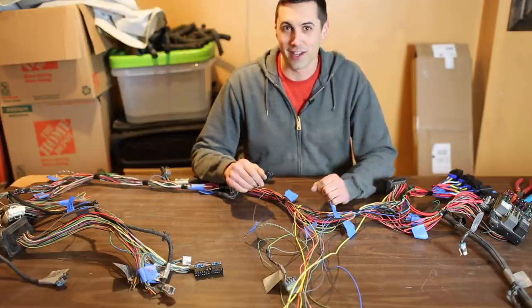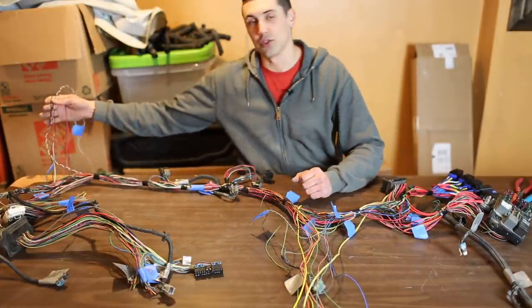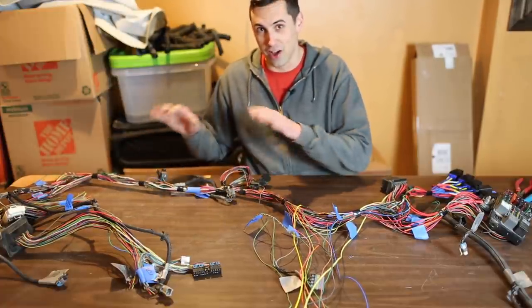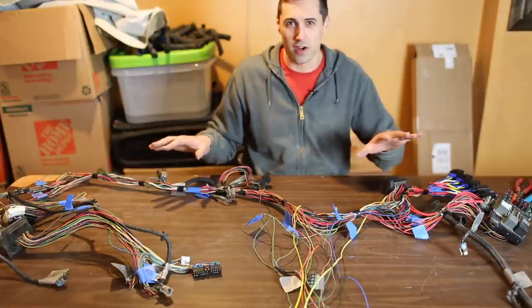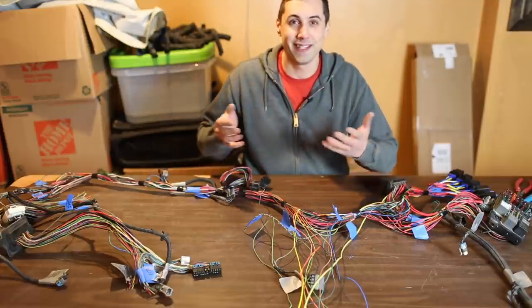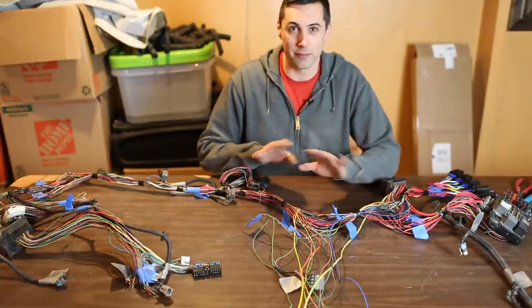I have made almost all of the connections and I'm just about ready to install this in the vehicle. Right here in the middle the harnesses are already combined and it's looking pretty good — almost professional. Over here on the other end I ended up needing to add six relays just to make everything work. In a nutshell, the circuits on the Dodge are generally ground switched while the circuits on the GM are switched on the power side. Using relays is an easy way to convert from one to the other. It has taken me days to work on this harness — it takes quite a bit of time to do things the right way, but in the end it'll be totally worth it.